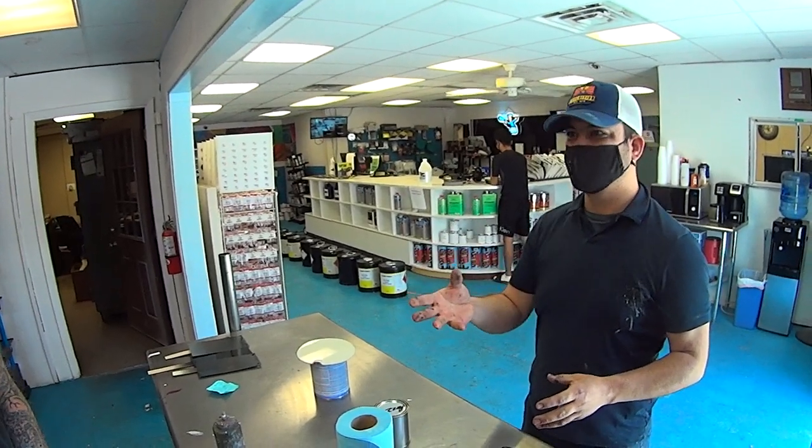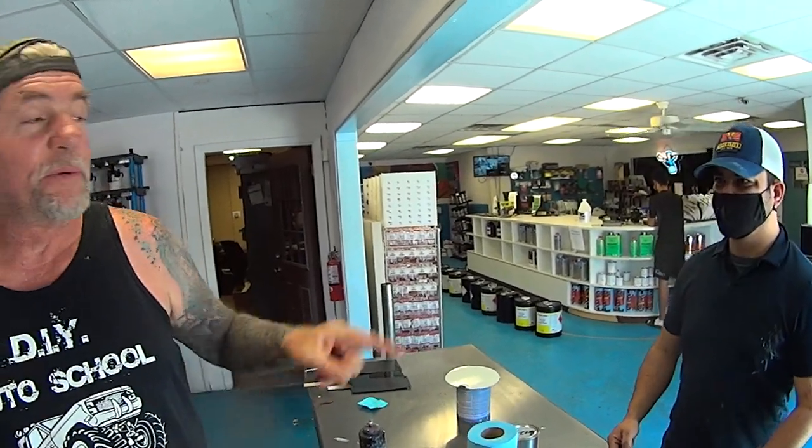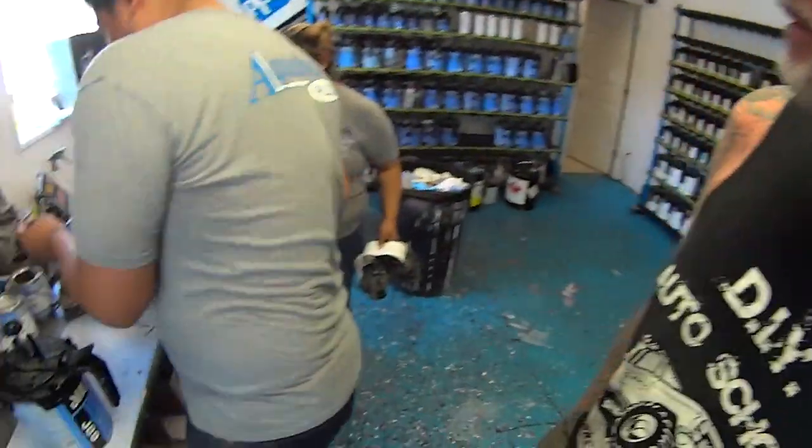Well, sometimes when it's real humid out and your paint turns cloudy, you want to put a cap full of accelerator in it, and then it'll dry quick and you don't have all that. Yeah, because that's what makes it foggy. Yeah, I see that. Remember that, bud. You need to keep a bottle of that.